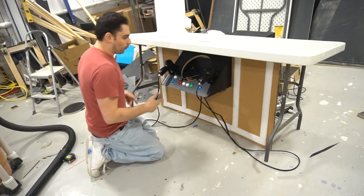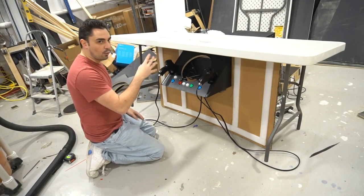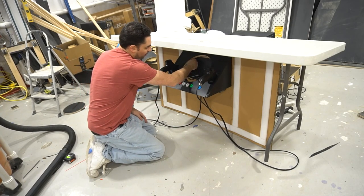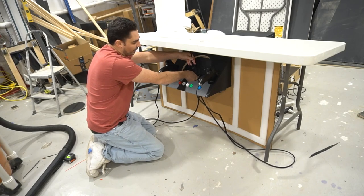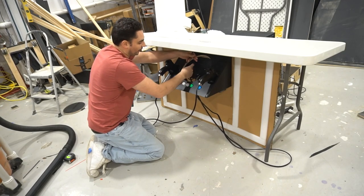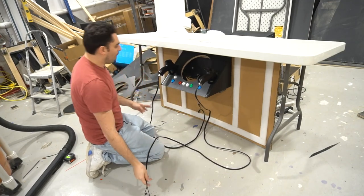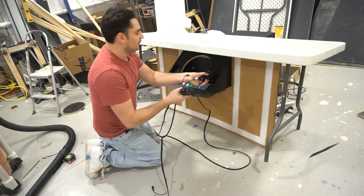Pedals are gone. Now we're going to work on the guns. Looking at the cabinet on the top left, I have another 4-to-1 USB hub. And the top two wires are going to the guns. Those are the only USBs also that have the barrel connector for the power supply. So let's get rid of the guns. Nice and easy. We don't want to pull wires. Just be sure you're doing a clean drop. We got one gun in our hand and we got two.